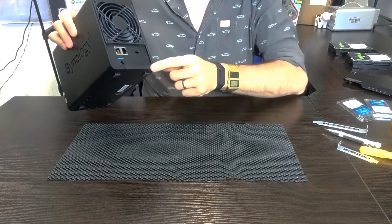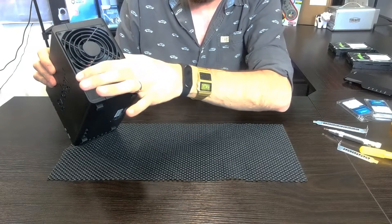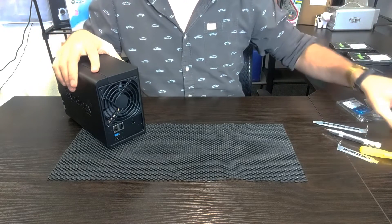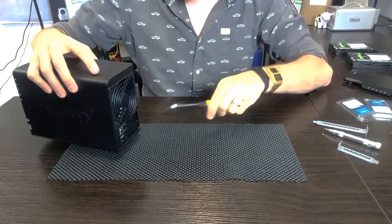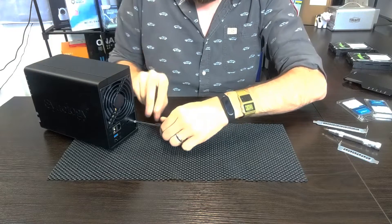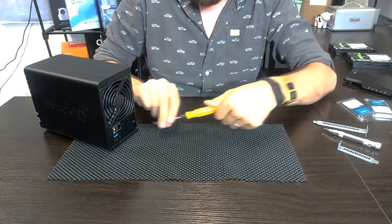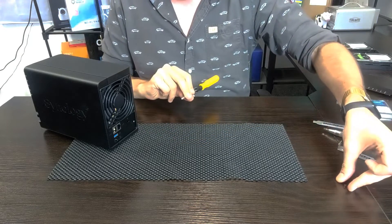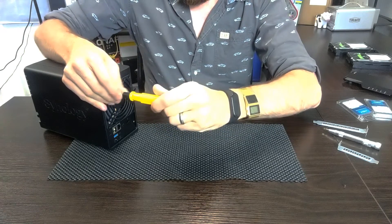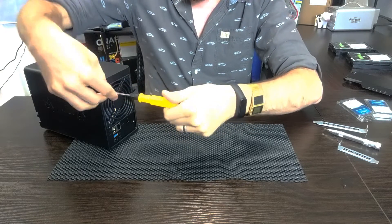What I'm pointing out on the video is regarding this screw — there's one tiny screw at the bottom right, and four screws that surround the fan. You don't have to remove the fan, but that bottom screw is hugely important. That screw is what holds in the USB 3 port. Those of you that have caught my 920 and 720 assembly videos will know that USB port is one of the things that holds the frame together. Make sure you've removed that USB 3 port.